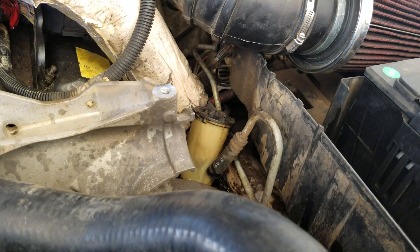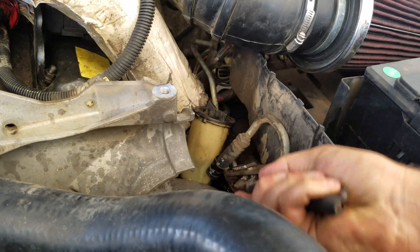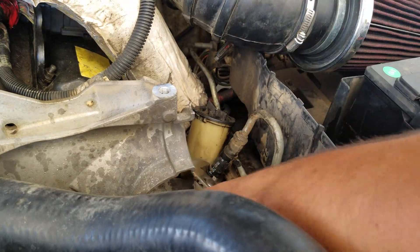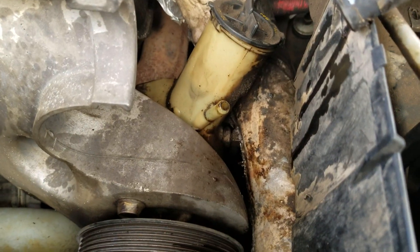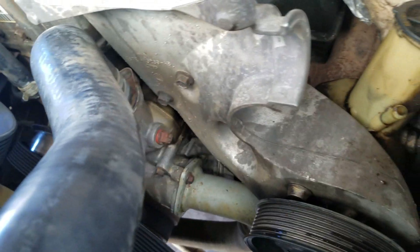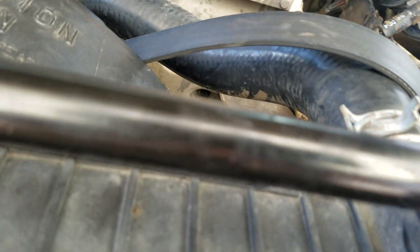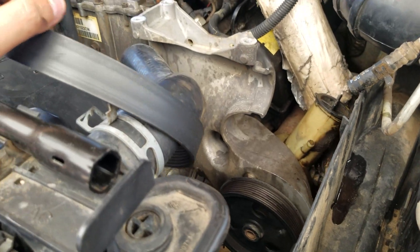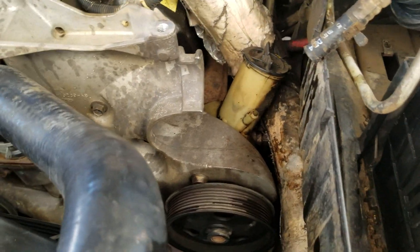Now we're looking down at the power steering pump reservoir. I'm going to take off the hose clamp and pull it up so it's out of the way — I should be able to slide this off. I have a bucket underneath to catch all the fluid. There's another line that goes into the side of the pump. I'm going to take these two bolts out, plus one down there — those three out — and then that whole plate is going to come out. At that point I'm hoping to have a better angle at that fitting because it looks like it'll be difficult while it's still in.